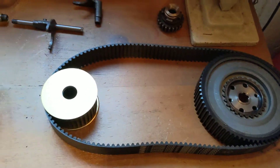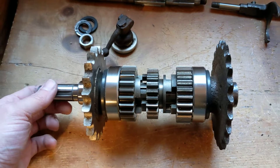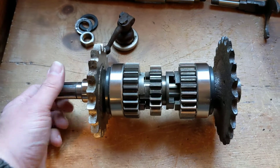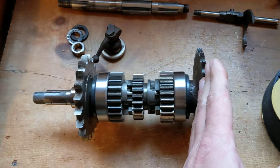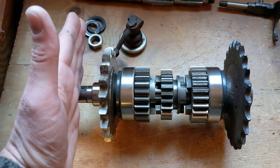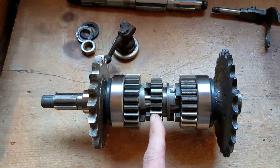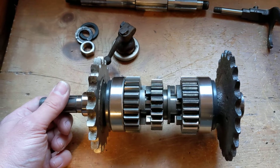In concept, this is what we plan to do with the gearbox. By running this in my hand, hopefully it should be very obvious how we plan to use it. We've got two sprockets - one on the left side of the bike, one on the right side. The clutch would be on the left hand side, so with the clutch engaged that central shaft will be turning and that central dog will be turning. Neither of the sprockets are locked onto the shaft.